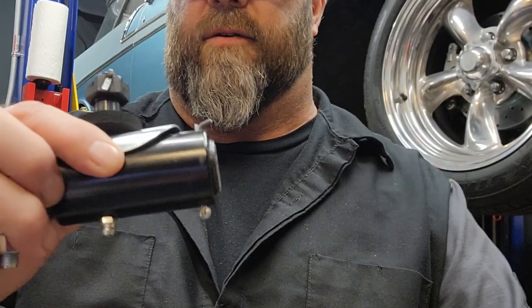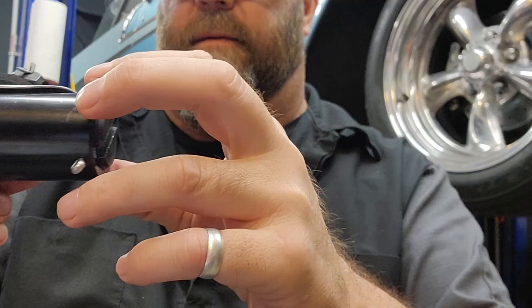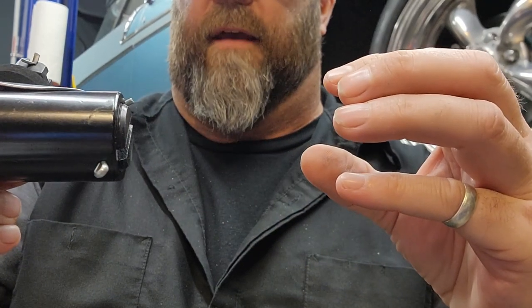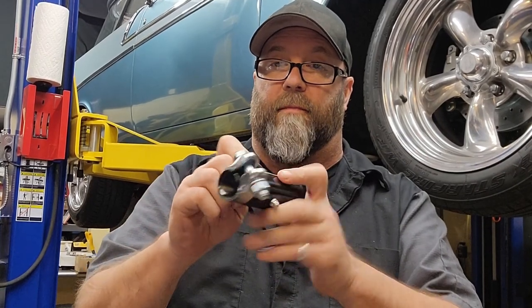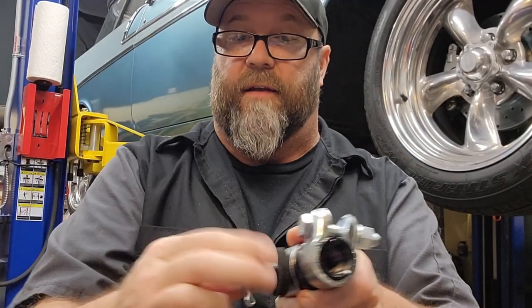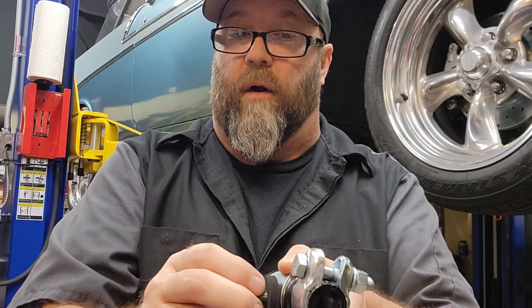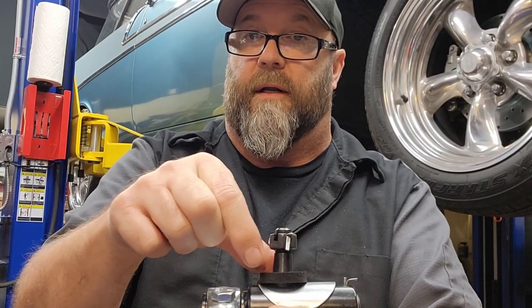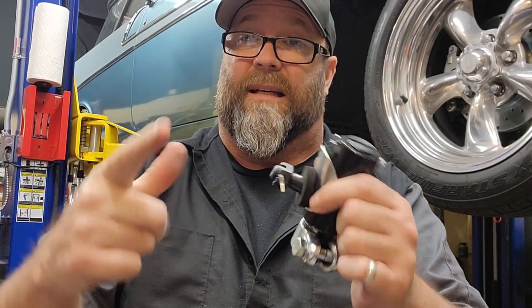This actually will sit. This is the driver's side. It'll sit like this. And that power steering control valve, I thought, unbolted off of this. And it's probably very similar. With power fluid going into that control valve, I'm sure it takes up what this spring does and creates that tension. But being that my dad eliminated the power steering pump and all that stuff a long time ago, that's probably why this slops back and forth. This is the piece that when you turn the wheel and it does this before anything catches, this is just going back and forth before it actually shoves the piece. You know, it's moving from here to here and then moving this, and then moving from here to here and then moving this.